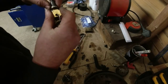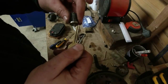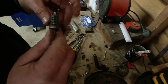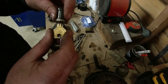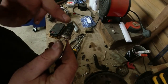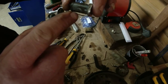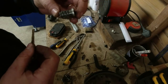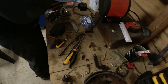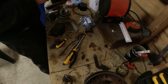It feels like they're getting better. I can feel the levers moving around inside here now. The levers are just literally like brass levers, for want of a better word, Richard. And the key goes through the middle of them, and then it pulls them against a spring, and then they all level out. So when you take the key out, you can see some of the levers are pointing in opposite directions, but not a lot of them. It really is not good at all, this lock. Probably 50 plus years old.